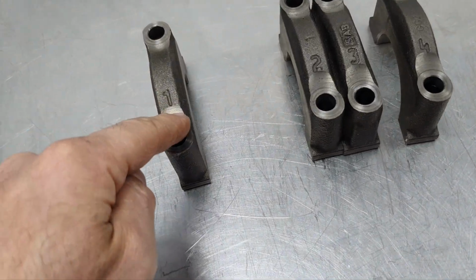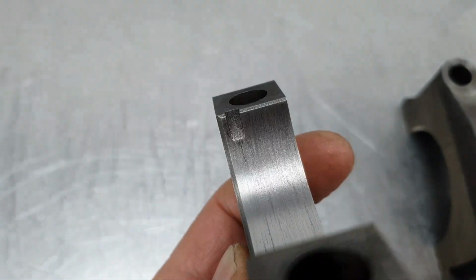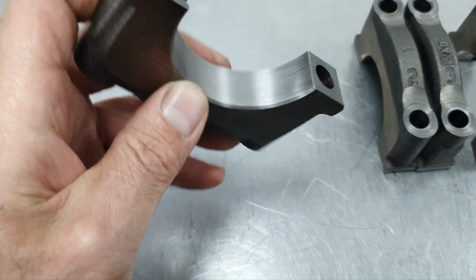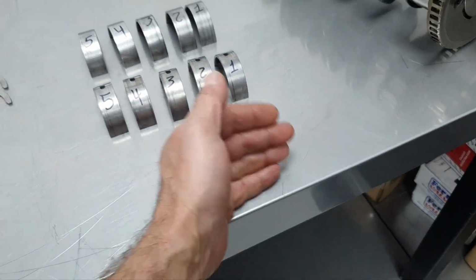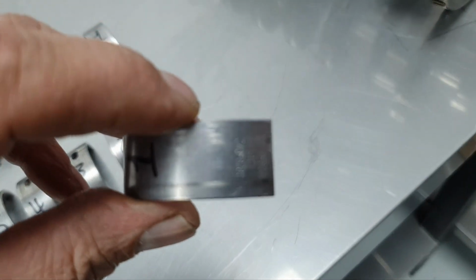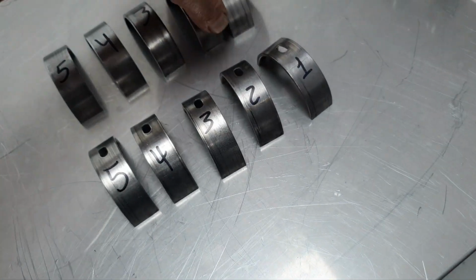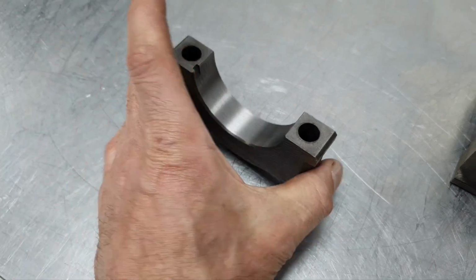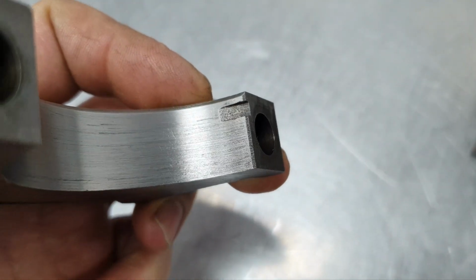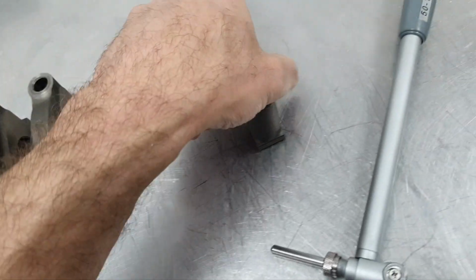All right, let's go see the number 1. Boom. Number 1. We had one naughty main bearing here, because of what happened here before, not with these main bearings. The main bearings, I have them here in order. It didn't happen to these, obviously. The previous one, you can see also the lines. These lines, what you see, on the bearing cell, correspond to the lines that the cap has. Because once upon a time, one bearing cell here was spinning with the crank inside of the cap. That's why you see all this.